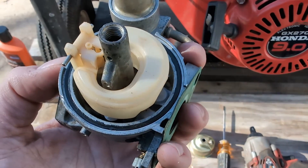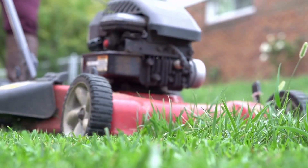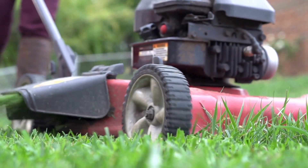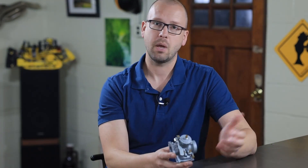This is especially common if you've just torn it apart and put it back together. If you've messed with your fuel pump or fuel regulator, just make sure you have the right pressure going to the carburetor. You'd be surprised how little pressure these things need — a lot of gravity-fed carburetors like on push mowers or small riding mowers are only going to be about half a PSI, maybe even less.